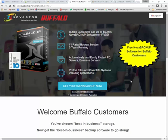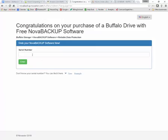All right, and that will dump us over to Nova Backup's website. So we're going to get our backup now and enter your serial number. I'm not going to put my serial number in there for the video because I've already done this, but you'll enter in your serial number. Oh, I'm sorry. The serial number is located on the back of the Buffalo. It says SN, and then there's also a MAC address back there which says MAC. So you want to make sure you get the serial number.